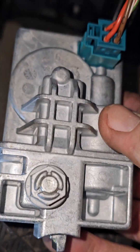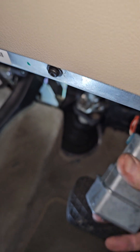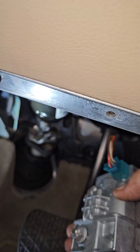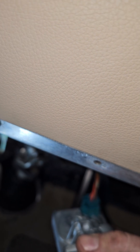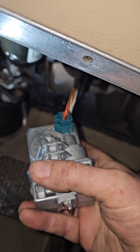So basically I've removed the ESL — here she is. This is a 2012 vehicle. This is mounted in this position above the steering rod. There's the steering lock plunger there, and there's the bolt. At the moment it's in the lock position because I tried the ignition to make sure it was working okay. Normally this bolt goes in and out in the unlock position. With the car in its unlock position and battery disconnected, this bolt moves up and down freely.